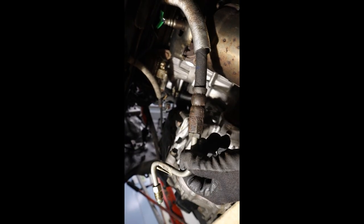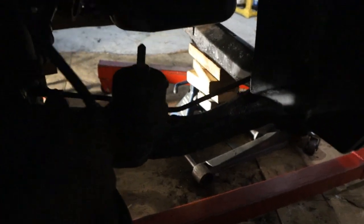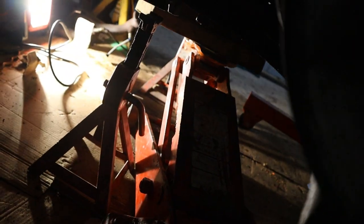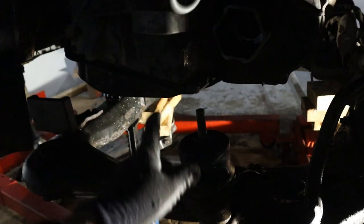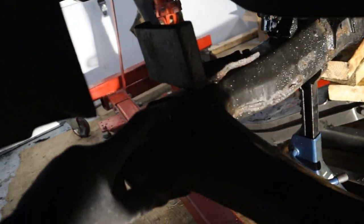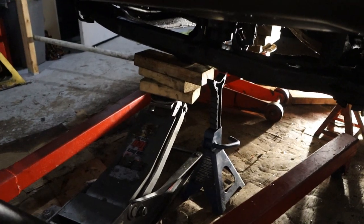The steering line that I busted — I was able to find a new replacement tube that just bolts right on. Now I am trying to align the subframe back with the body of the car. The engine mount needs to line up, and I am using jacks and jack stands to lift the subframe up while the crane supports the engine and transmission. On the driver side I will have to get the transmission mount aligned as well as all the subframe mounting points with the body — so let's slowly jack up that subframe to get it to line up.